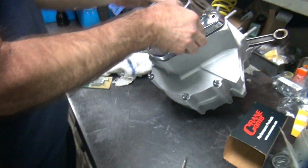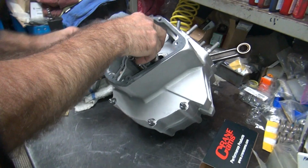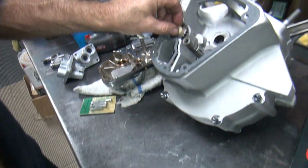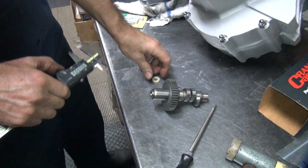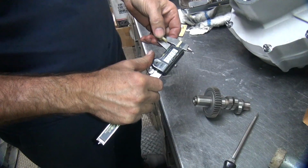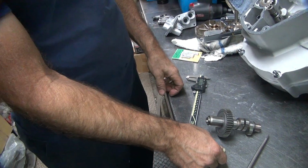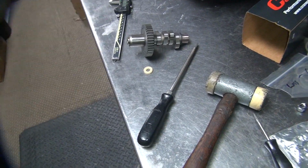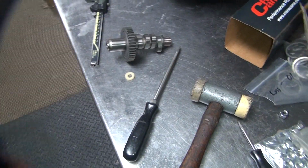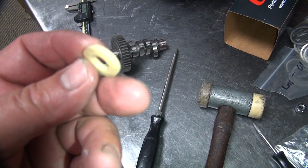Okay, there's something about that disc I don't understand. Okay, so this here is too thick. We have a thinner, thicker, and thinner. Well, it's not supposed to be plastic, it's supposed to be steel anyway. But okay, this is a 135, that's why there's no clearance, it's pretty tight. Usually they're more like 110, 115. So you need to get one that's a little bit thinner than that. I'm sure you got one in your box before, right? Yeah, I got them laying around, doing nothing else, but ready to go back together.